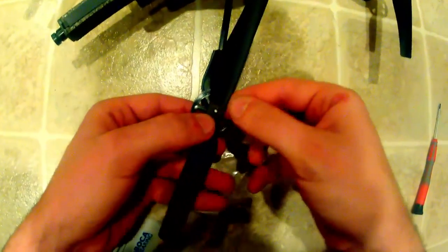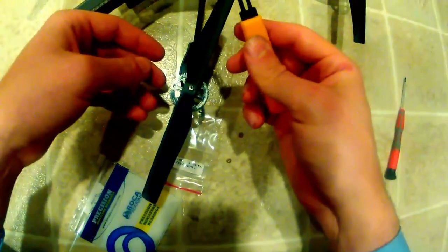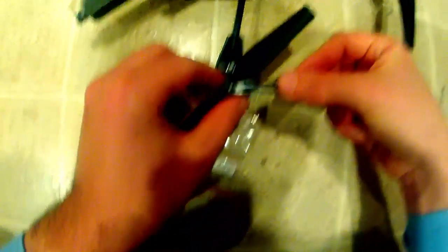For putting the clip back on — right now the clip ring is too high, so I'm going to slide the shaft down a little bit. Now it feeds on. Here I can either use the Parrot circlip tool and push it on like this, or the other way I've done for years is tiny needle nose pliers gripping on the far side of the shaft, and driving it on like that.